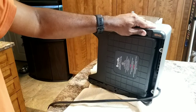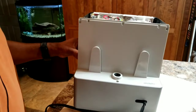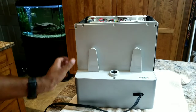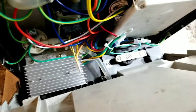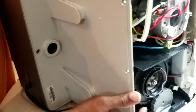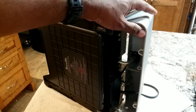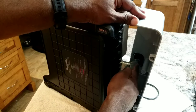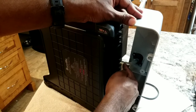Now that I have removed everything, it's coming out easily — that makes sense why it was hard to remove before. Now let's have a closer look. You have to lift it up a bit. This is what we see inside, and that's the water line that connects — that's where the water goes inside the machine. To remove the back portion you need to remove those two screws holding the black piece — that's where the water tank plugs in and the water flows in through this pipe.